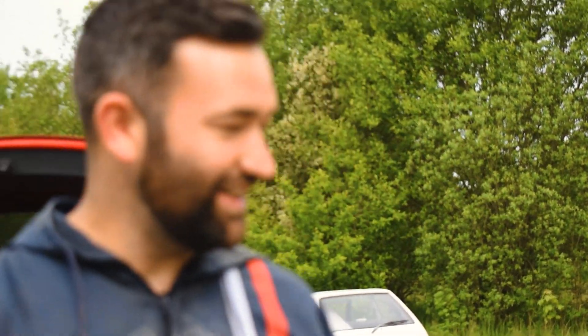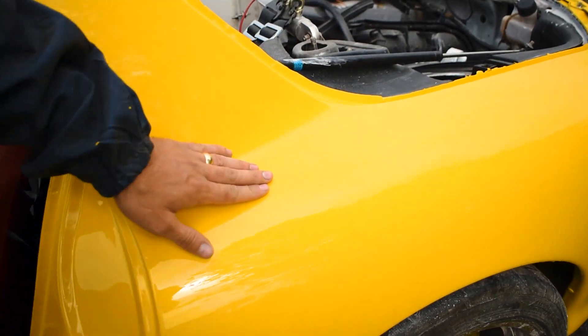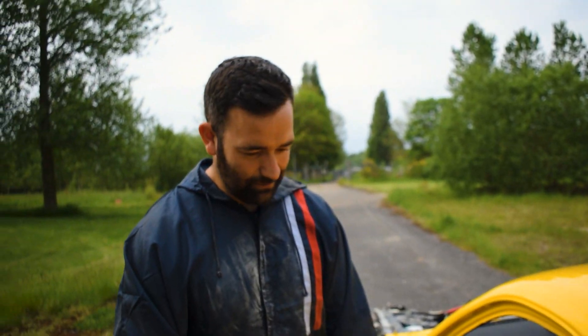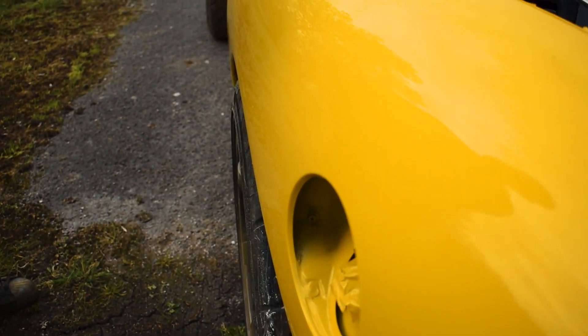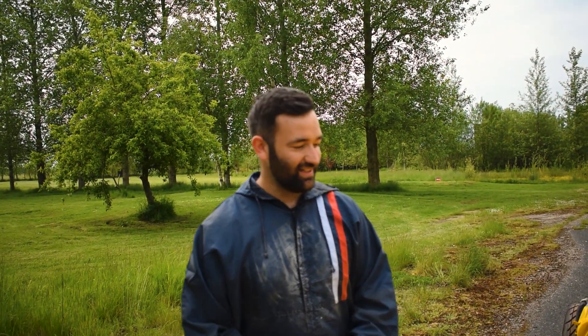So you happy with it then Mike? I am mate. I need to remind myself that I'm not a professional and I painted it in a dusty booth with no extraction. There are a few little bits on the car I'm going to have to buff out — a little sag around here in the lacquer, a little run near the filler cap, and a few little dust nibs you'd probably get on most paint jobs anyway. These runs are mainly due to the lighting because you can't see how wet the lacquer is going down. But this is my first full paint job on a car and it's cost me about 600 quid in total, so I am over the moon with it. All we've got to do now is paint the rest of it. Next video will probably be Jordan doing a cinematic on the full car — we'll do a reveal on it. Still got plenty of work to do. Thanks for watching, smash that like button and I'll see you next time.